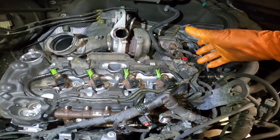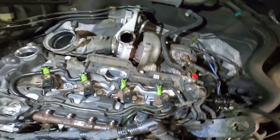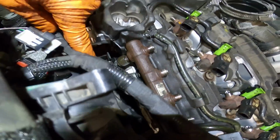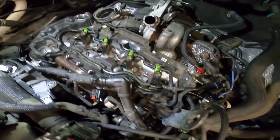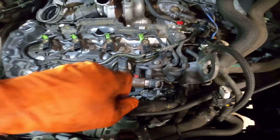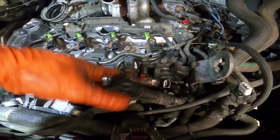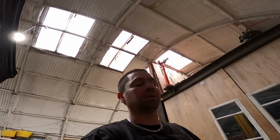Then it's flat the wiring loom back over and stuff like that. Obviously the vacuum pump's done. Put all this foam thing back in as well. Put the fuel rail back on down there. That's just held on with 2 little 8mm. Got to make sure to tighten up the high feed hose from the high pressure pump up. It's all coming back together. Got to plug the fuel pressure regulator back in. Fuel pressure sensor here, that needs plugging back in. Basically, it's going back together. How it came apart, just some things not in quite the right order. But yeah, I'm cracking on.